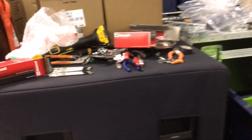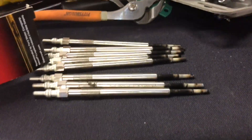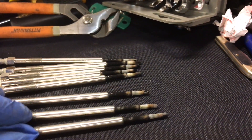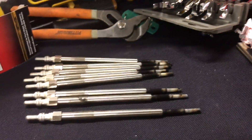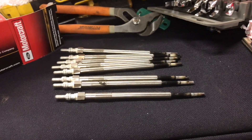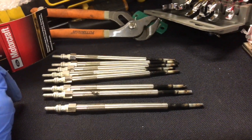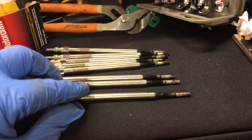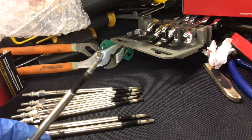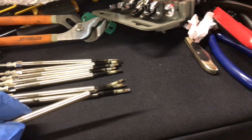We are done. That last one was pretty terrible, but it's still not as bad as having to take the valve covers off. Here are all eight — you can tell they've definitely been used. The reason I changed these is mine ended up being very early 2011, made in 2010, which fell in that code of that time period where these were breaking off and supposedly causing damage to the cylinders.